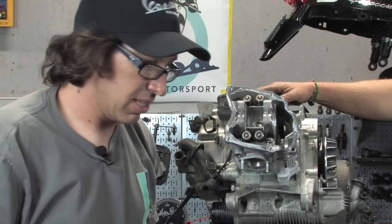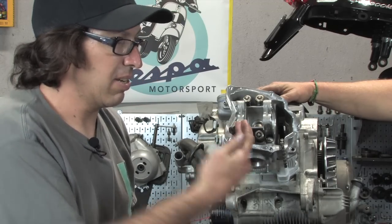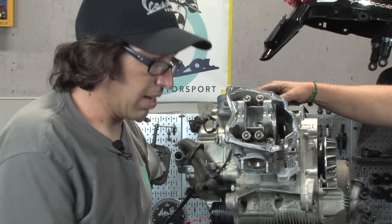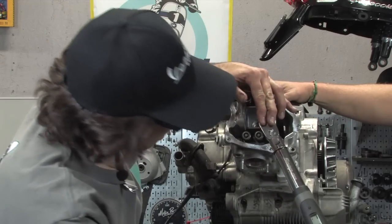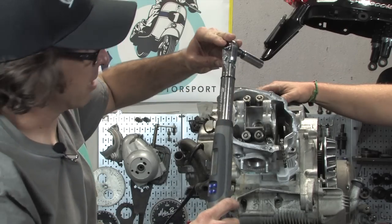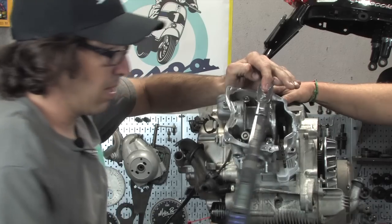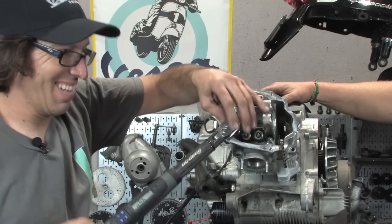Next, I'm going to set this torque wrench to 90 degrees. You could do it visually, just put a wrench here and turn it 90 degrees, but this thing, I could set it to 90 degrees. Basically, calibrate it, 90 degrees. All right. Wow, that's cool. So basically, I'll get it on the first one I torqued, 90 degrees. That's about 18 newton meters right now, actually indicates how much pressure it's actually put on the bolt. 90 degrees. Look at the torque, ladies and gentlemen.